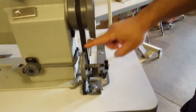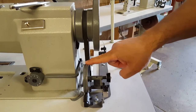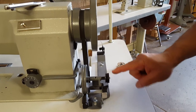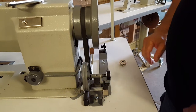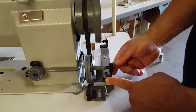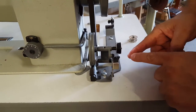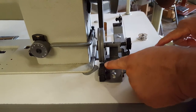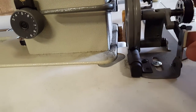Okay. So the belt on the sewing machine, as the wheel is spinning, is driving this wheel. Okay. So as it spins the winder around, the thread comes and loads on. A couple things we want to understand: when the bobbin becomes full, this little lever flips up and stops the action. The wheel that's being driven bounces against this little rubber pin here. Okay, and that's the brake.